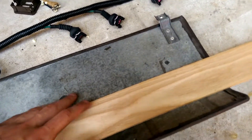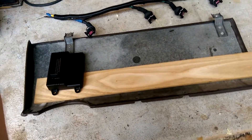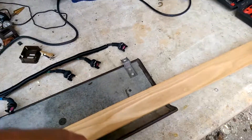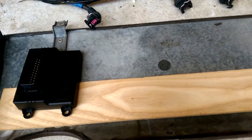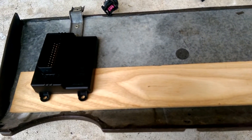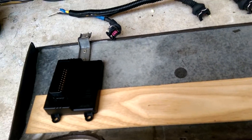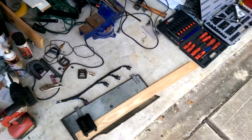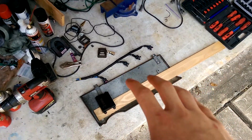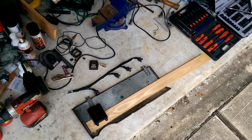A lot of it is just waiting for parts right now, but I think this could work pretty well. This kick panel mounts in the factory spot under two screws and I can take down the whole thing — no more screwing around under the steering column trying to mess with the DME relay. So it should all be right here. My hope for this car is to have it fully standalone, all engine wiring just right here — all new stuff, all accessible and diagrammed and looking nice.